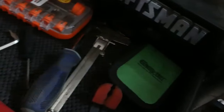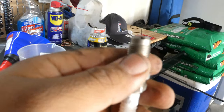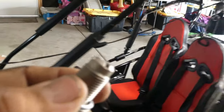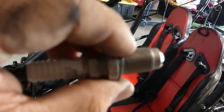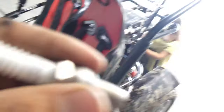If you guys have anti-seize, I would suggest putting it on the spark plug threads. I don't have any at the moment, so I'm just going to install it without. Later I'll go to O'Reilly's, get some anti-seize, take it off, put some on, and reinstall it. For now I'm just going to run it in.